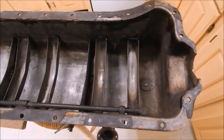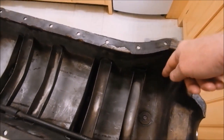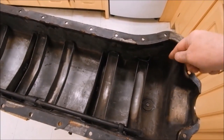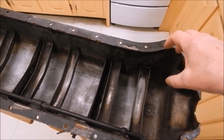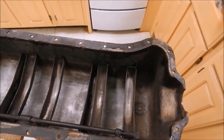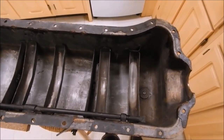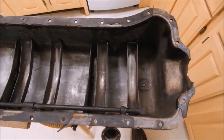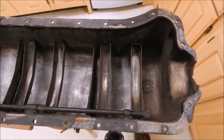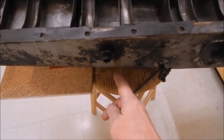The way this car is oiled is nothing like a 1970 car — this is a hundred years ago, they didn't have modern systems. The oil pump is over here; that's why it's shaped like that. It's way over on this side, out of the way of the camshaft and crankshaft. The camshaft drives the oil pump, which pumps oil up through a tube to the dashboard. It sprays the oil against a glass sight on the dashboard so you can see the oil is circulating — there's no oil pressure gauge, just a sight glass.